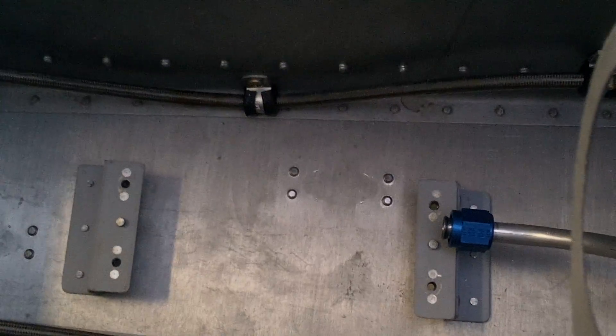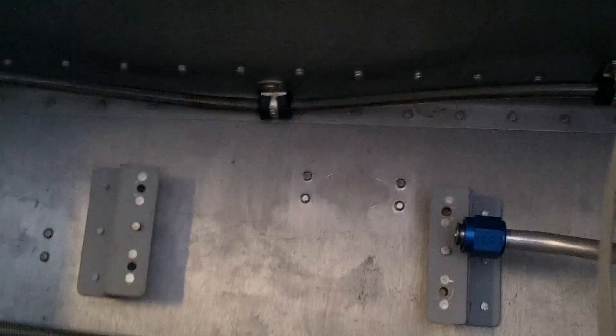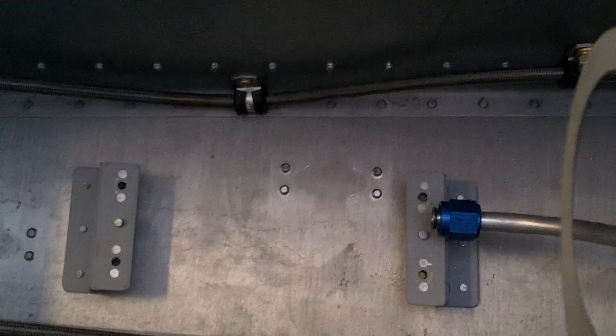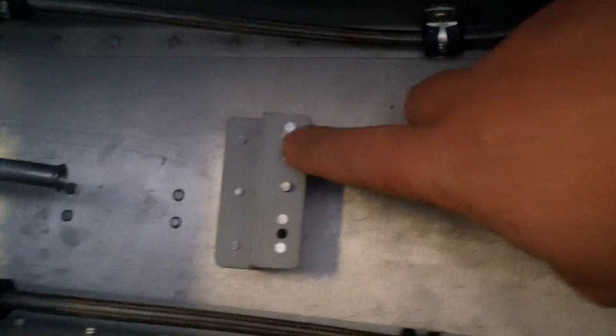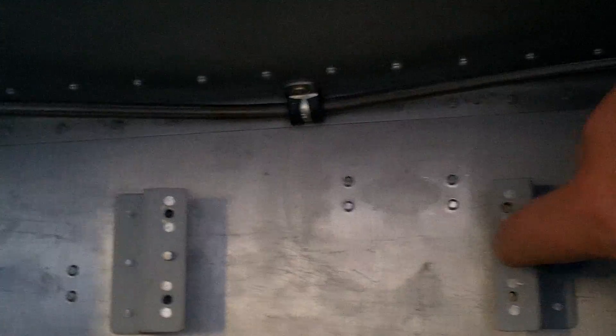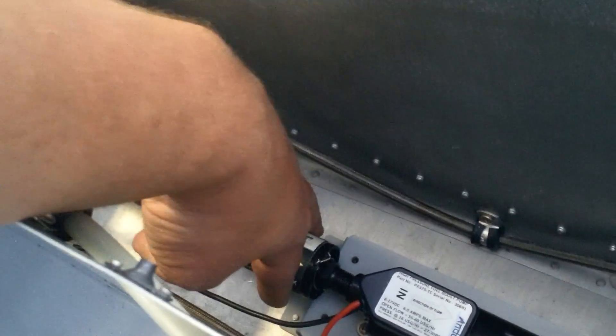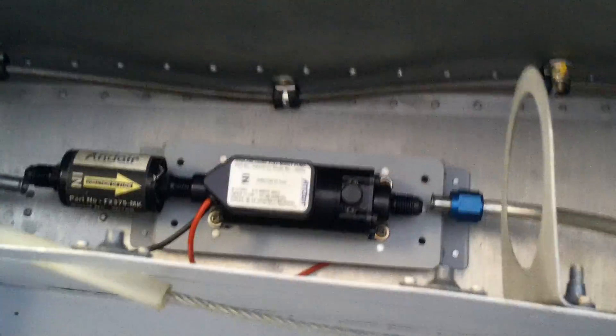One of the interesting things I did is that once this thing gets built, my ability to get back up in here and actually position things gets severely limited once the interior and cabin top go in. So I've put in an extra rivet right in the middle here on this one, and an extra rivet right in the middle of this one — they stand out. Those are essentially guide pins that drop into these holes. So from a distance, sometimes operating on feel, I can take it, drop it in, and once I get on those guide pins, just like that, the fuel pump is in position and all of the nut plates are lined up. All I have to do is drop those screws into the nut plates and put this thing into position.